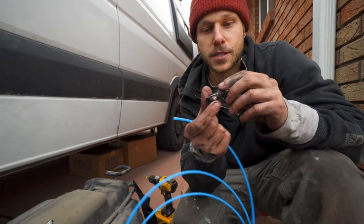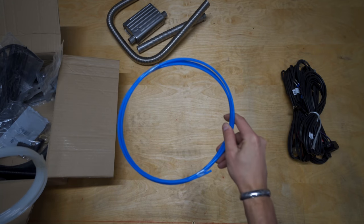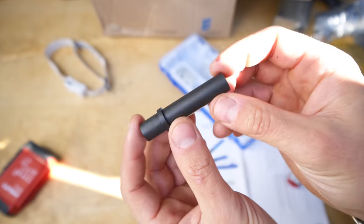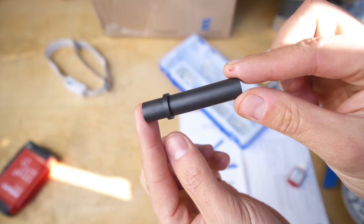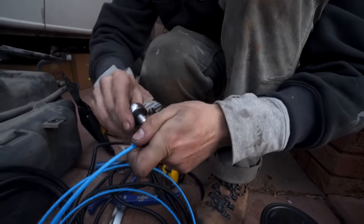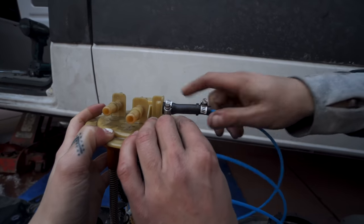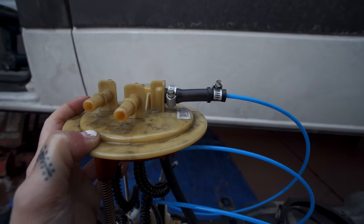Seems pretty good. With the passageway open, you can attach the external fuel line that you'll run to your diesel pump that came with your heater. You'll find that they provide you with a rubber fitting that goes from 1/4 to about a 1/16 inch fuel line, so you can attach directly to the nipple with a little force and then step down to that smaller size. That ain't going nowhere.